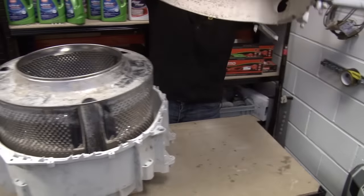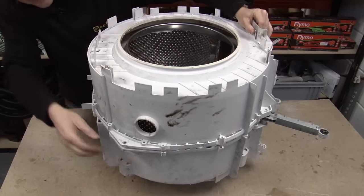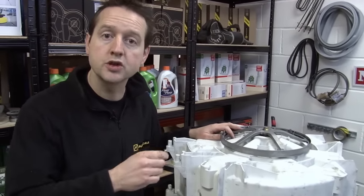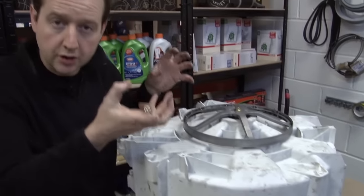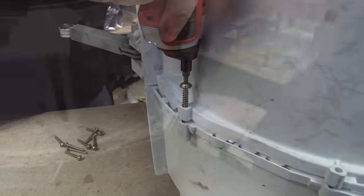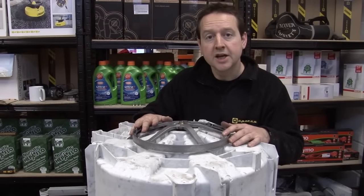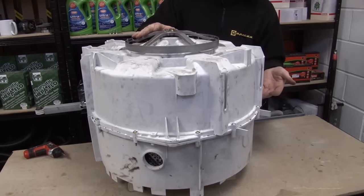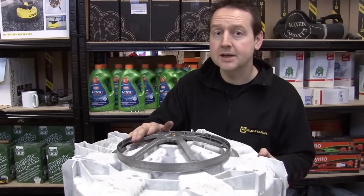Now I can put the front half of the tub on — just make sure we've got it lined up. I've turned the tub onto its front again and it's now time to put in the tub screws. On some machines the screw holes are numbered and you need to follow the right sequence. On this one I just want to do all the opposite sides as I tighten them up, just so that it pulls together nice and evenly. That's my tub all back in one piece. Now if you wanted to check whether yours was watertight, wait for your silicone sealant to dry, just flip it over, fill it up with water so that the water line is above the line of the seal and check for leaks. I'm quite happy with this one, so it just remains for me to put the whole machine back together.